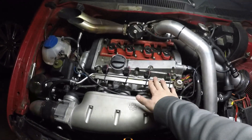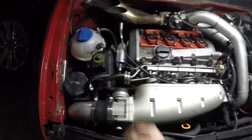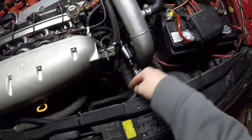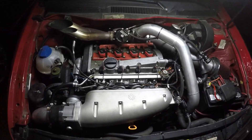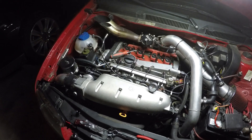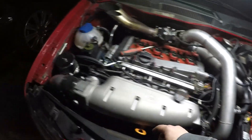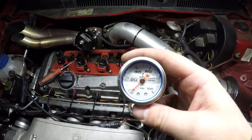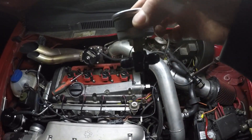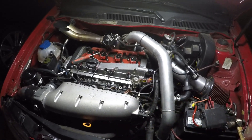The first thing I'm going to do is pull off the stock fuel rail and the lines we're not going to be using. I have the AN lines routed so we can put it into the fuel rail right here. Here's where the return goes, so I'll get rid of this and then this filter. I'm going to swap the fuel rail over first before changing the fittings because the other one is stuck in there and I can't get good enough leverage on it. Hopefully after I bolt it in, I'll be able to torque on it and get it out. We are done with the first step — I took the fuel line out that used to go right here, and looped this one over and disconnected it from the feed hose. This is going to be our fuel pressure gauge, which is going to go right into the regulator. That was just inline so I could know what fuel pressure was with the stock setup. Next, I'm going to pull the rail off and get the other one swapped on there.